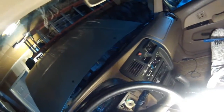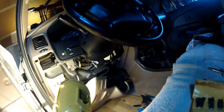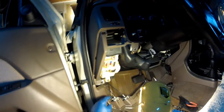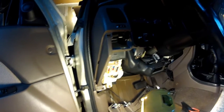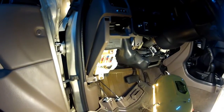So now I've got this decorative piece back in place with the four screws — one here, two up there, and one down here on the little tab. Next I'm going to get this kick plate back on. It still has the hood release and the gas fill hatch release connected. Since it wasn't too much in my way, I just kept it attached and folded it down onto the floorboard.